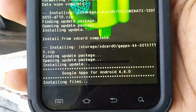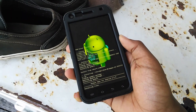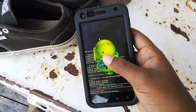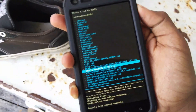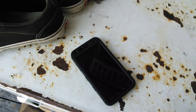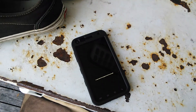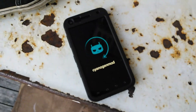Go ahead and install Gapps for Android 4.4 — specifically the KitKat Gapps, GApps_KK, that's the one you want to flash. It is installing those files. After this, of course, you'll flash your SuperSU. Some people have problems with SuperSU saying they're not rooted — there's an easy fix for that. I found it out myself. All you have to do is check off one box in the SuperSU settings and you'll be straight. Let's go back and reboot our system. And you now have CM11, CyanogenMod 11, Android 4.4.1. None of that ugly yellow triangle stuff, because you used Mobile Odin — not the desktop version. You have CM11, you are ready to go.